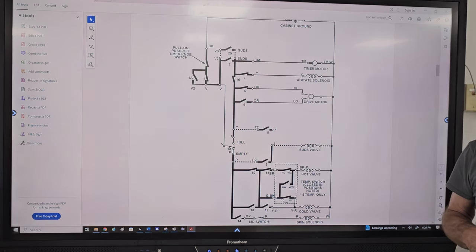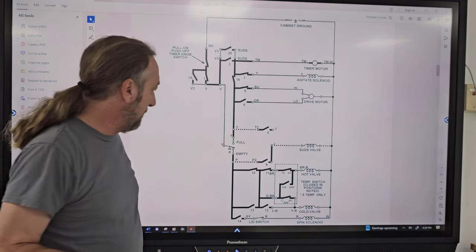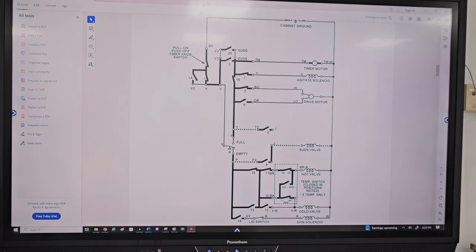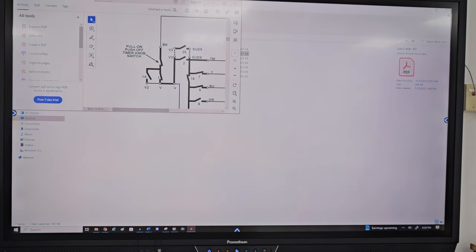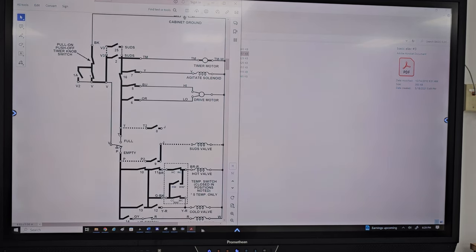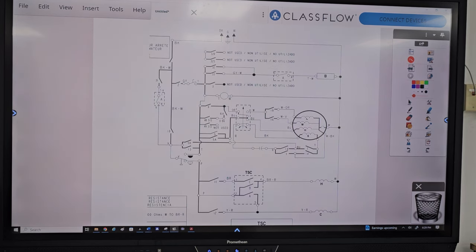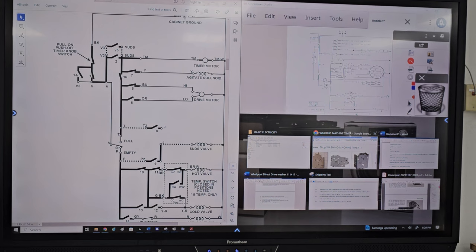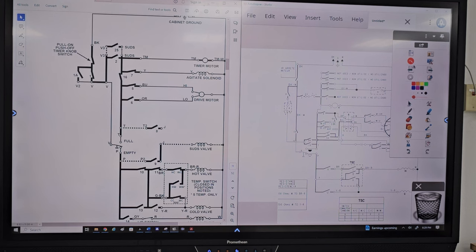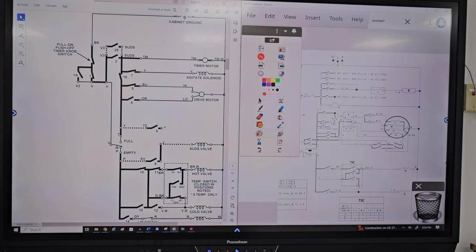Look at your water level switch. Is the common violet, top tan, bottom pink? I can put them side by side so we can look at them together. So the top is violet, it's tan. Okay, so this is this one. But it's just something I want to show you guys again. Why does it not go full screen? Okay, I have to move this out of the way. I know it's going to be a little hard for you to see, but you guys have the diagram.